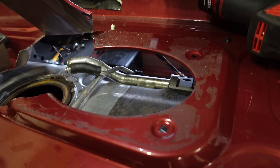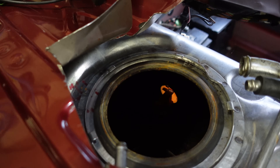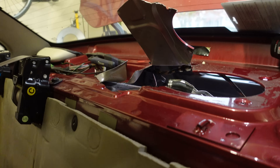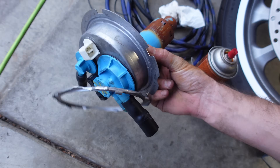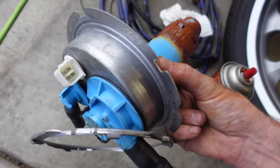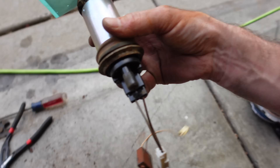This giant six-by-nine hole is a factory location and there's a rubber cover that goes back on it. I bent up some of the metal after we created the hole, and now we have access to the tank. The fuel pump sits down on the bottom, with a mount that screws into the bottom and holds the pump upright. Once you get that giant access hole made, you can get all of the evap stuff, the auto vent, and the tank pressure sensor off the top. This connector is where the pump power runs through, down to the pump in the bottom of the tank.